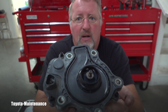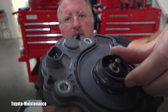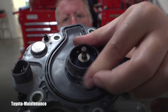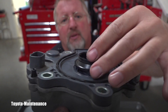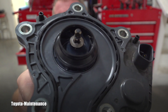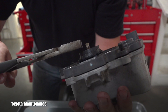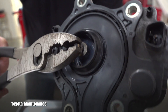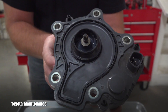This pump was removed for the reason of the slow overheating and that code. Look at the detail — this is the propeller and I can barely turn it. Look on the inside and observe the shaft of the motor. What's happening here is the propeller has separated from the shaft, and the shaft cannot be moved — it seems to be seized. I'll grab pliers to turn it, and indeed it is completely seized. That electric motor is completely kaput, and that's why the computer was showing that code.